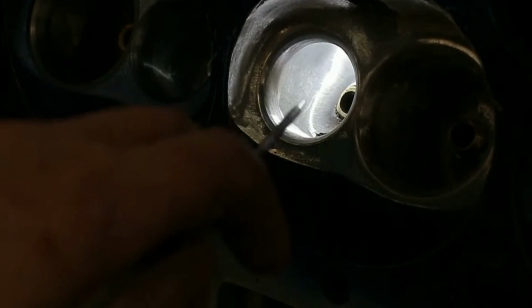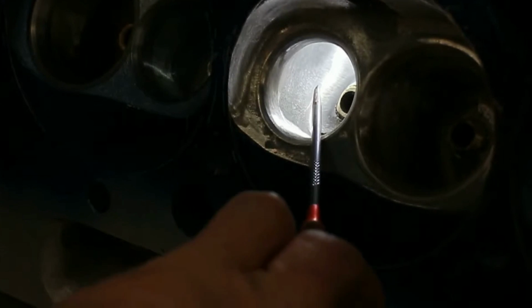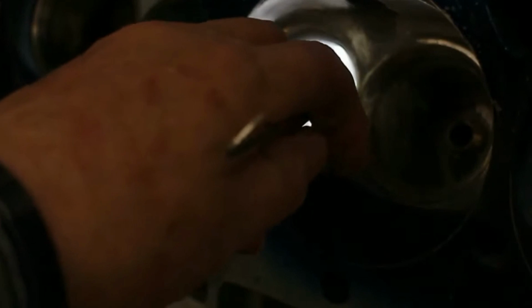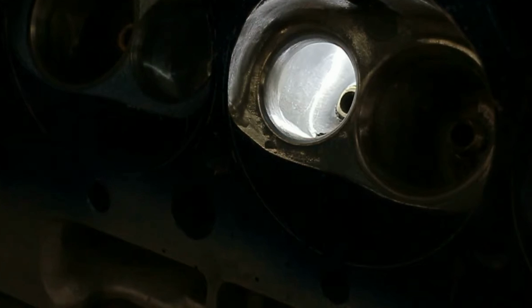Here's the exhaust port. It's a bit overlit compared with the rest of it, but I'm sure you can see what's going on here. This is the cylinder wall side of the port. The exhaust is going to be going out this way here. So I've cut this here, skinned this side of the guide boss down, and opened up this area here and given it a much more smooth turn into that there. That's it. We're going to now see if this extra bias emanating either to or away from the center of the cylinder pays off. At this point, we've kind of run out of time on what we can put into one video. So I'm going to leave you with a cliffhanger here.